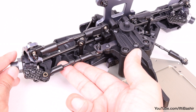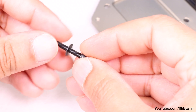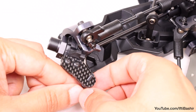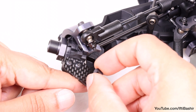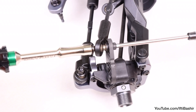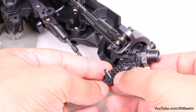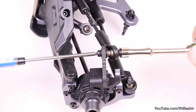All that's left is to secure the steering links to the spindle arms. To do that, feed an 8 millimeter washer through a 20 millimeter steering link screw, which feeds through from the bottom of the spindle arm. Drop on another two washers included with this bag, then drop on the steering link, finally tightening into place using a lock nut. Repeat the same process on the opposite side and secure with a lock nut.